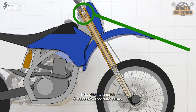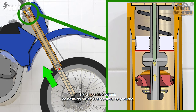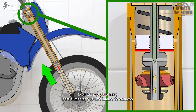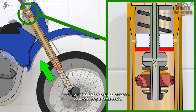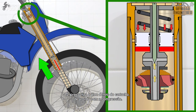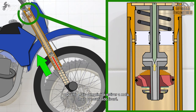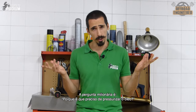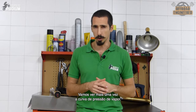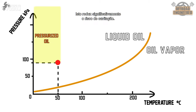This simple system is responsible for two things. Number one, it compensates for the extra volume of the piston rod entering the cartridge — the free piston can rise to increase the internal volume of the cartridge, keeping all the oil inside. And number two, it pressurizes the oil inside the cartridge according to the compression; the more the free piston spring gets compressed, the more pressurized the oil becomes. The million dollar question is: why would you need to pressurize the oil? With the oil under pressure, the lowest achievable pressure inside the cartridge increases, greatly reducing the risk of cavitation.